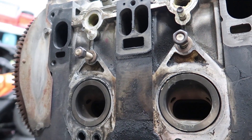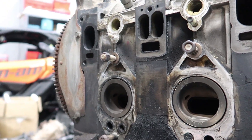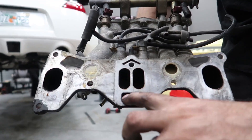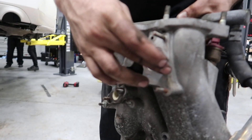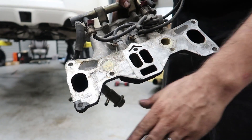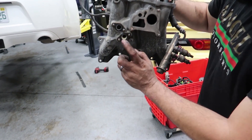When you put the new turbo manifold for a single turbo, all the EGR stuff gets blocked off. Technically from the top these ports come down and go around to the side of the housing, up through here, and then to the intake to the EGR valve — it builds a lot of extra heat inside the housing. It would be cool to get a gasket that blocks it off. People will just block it off right here or weld it shut and completely get rid of it — that's probably the better option so you don't fill the whole intake with exhaust gases.